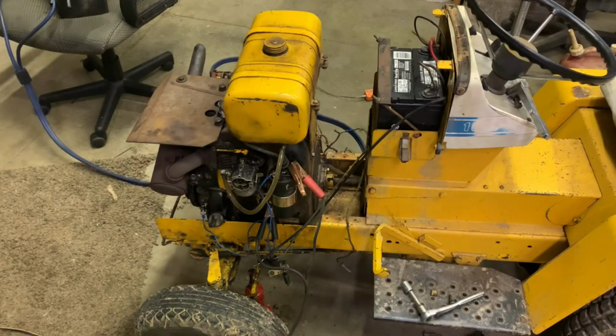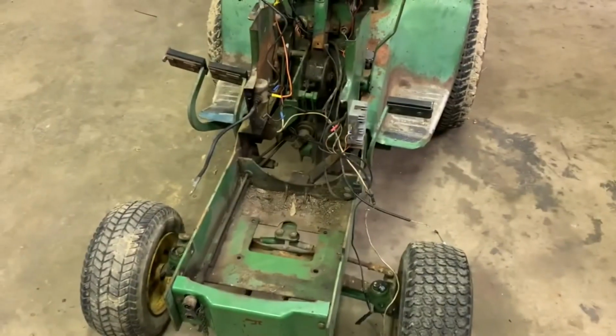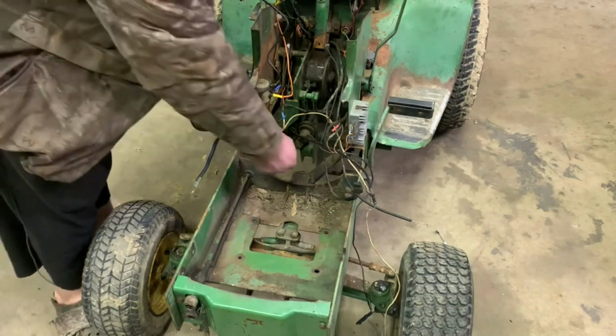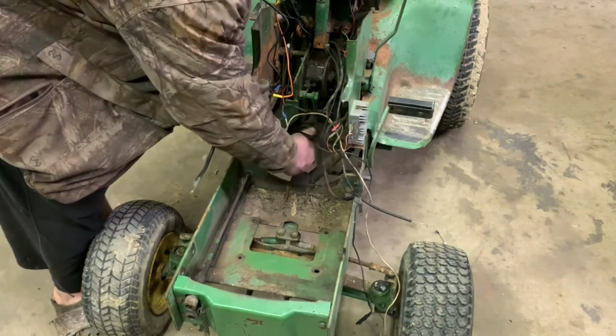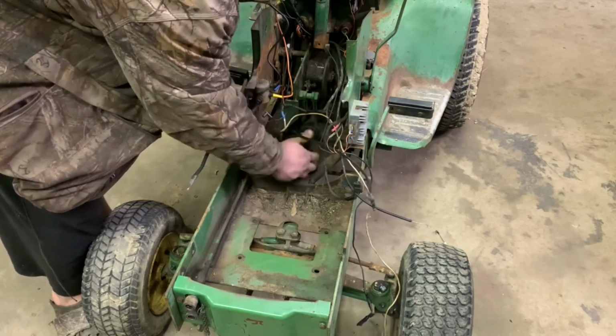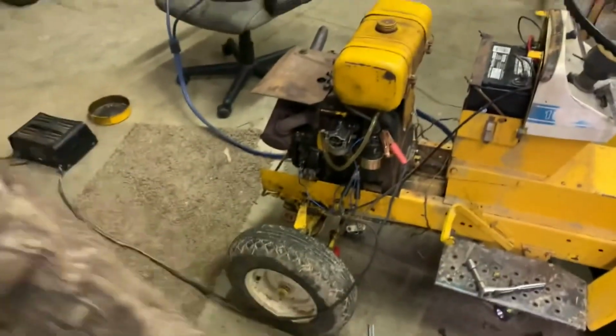Okay, so what could be the issue with that pump? You know what I wonder? I wonder if it's the fluid that's in that pump. Let's try something. I got another hydro sitting over here. This is the exact same thing. This is a Sundstrand 15U, which is the same pump that Cub has. Yeah, see that one? That one feels like it almost turns about the same. Maybe we should pull this engine back some and find out, see how it turns compared to that transmission.